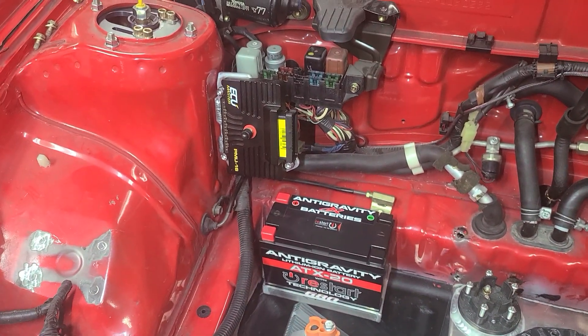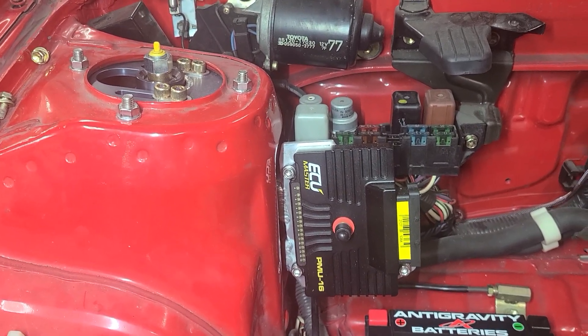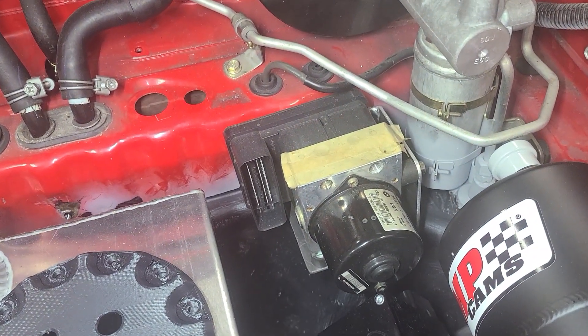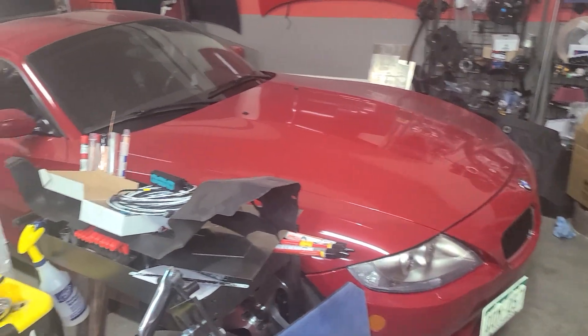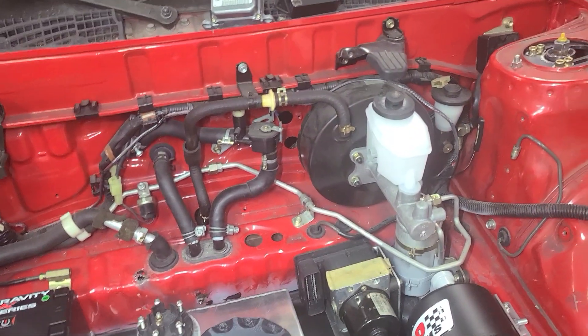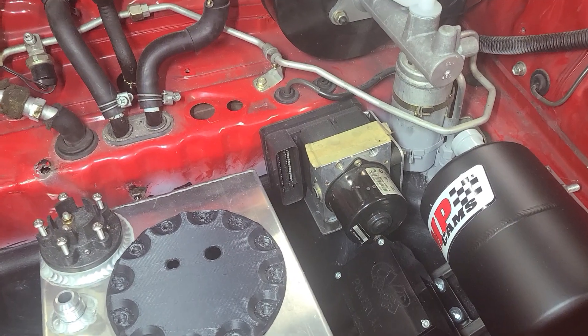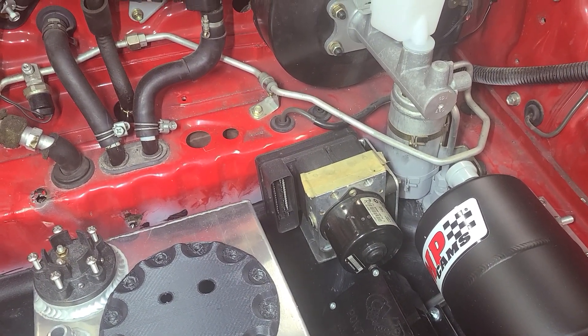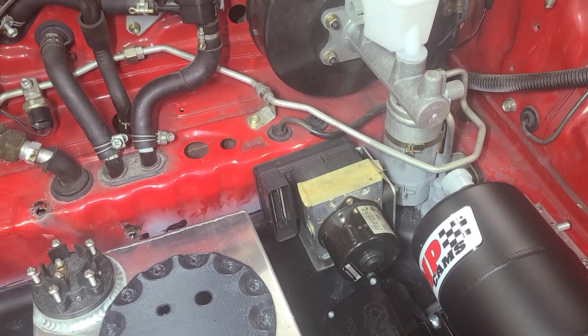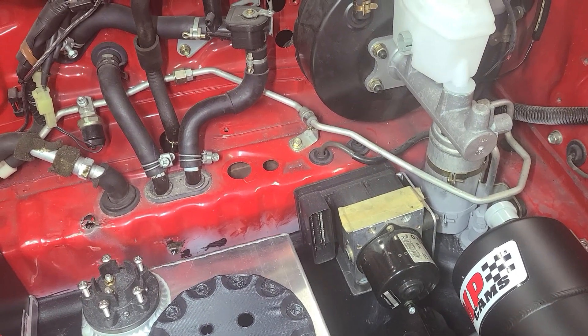A lot's going on in here — I'll keep it high level. I've got a PMU16 which will help control all of the additional electronics I'm adding to the car. For ABS, this is an ABS unit ironically out of a BMW — much like the one in my Z4M coupe over here. The E46 M3 and my Z4M have an ABS system you can technically retrofit onto other cars; it's a true 4-channel ABS system, and with a little bit of tuning you can add ABS to pretty much anything.